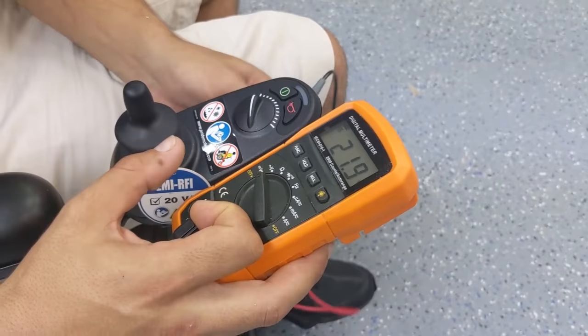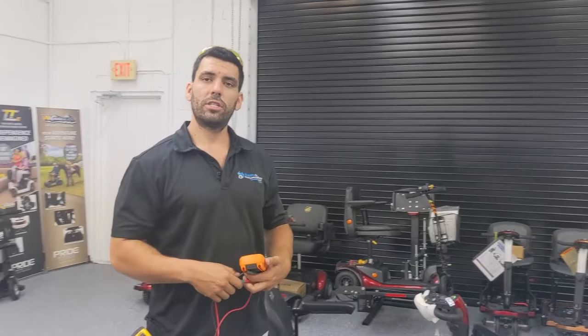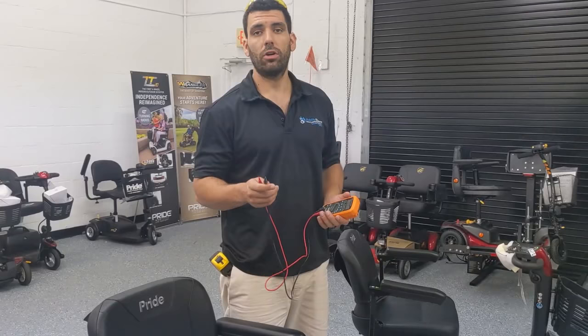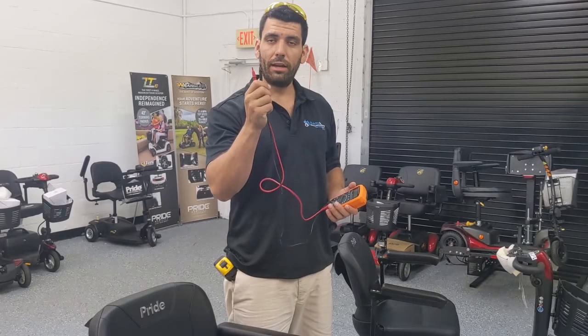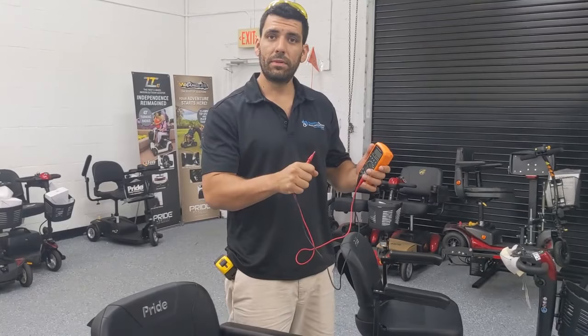That is how you test your battery both under load and not under load — to see if your batteries are charged all the way and if they're working properly while moving. Just having the voltage meter read 25 volts doesn't mean your batteries are good; it just means they're able to hold a full charge. How long they can hold that full charge is the important question. Use the two probes on the left and right side of the XLR charging connector port, give it some gas, and you'll know. I hope this video has been helpful — tune in for more troubleshooting videos just like this one. Thanks for watching, I'm Sergio, have a great day.